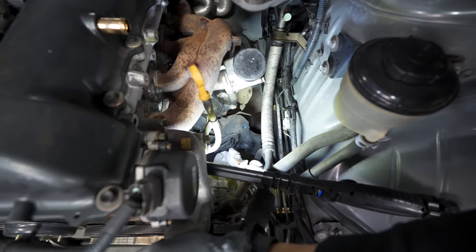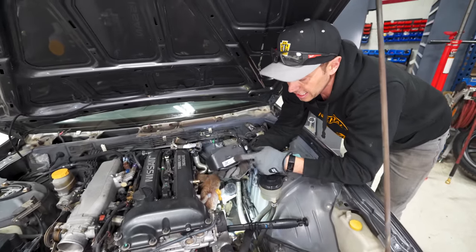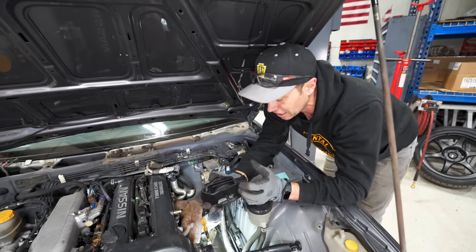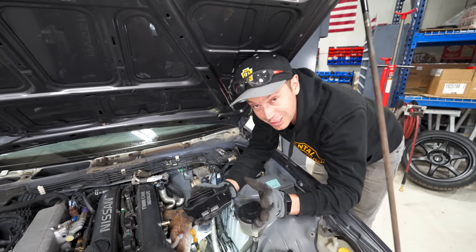So you can imagine once you start driving this thing. I had a look at it, all the rubber's starting to crack on it. I'll show you once I get it out. But I am going with a set of hard race engine mounts. The whole set does come with the trans mount as well. These are rubber, which is a big thing for me. I don't like the poly ones. I've run them before, and the full metal ones are just race only unless you're super hardcore.